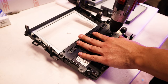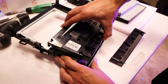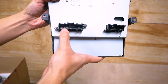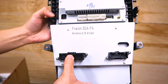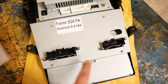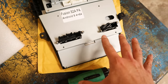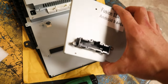It's a little small but shouldn't be too complex. As you can see here, it has these two little ports at the bottom that do not have pins in them, so we're actually going to be reusing our old AC board so everything can read very easily. We've got eight very small screws in total — one in each corner which is four, two here on this port and two here on this port. You don't actually need to remove the ones around the port; these are going to help you line everything up. Whenever you have the other ones done, this just comes right off easily.